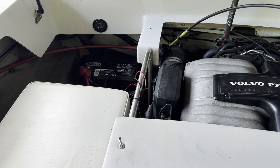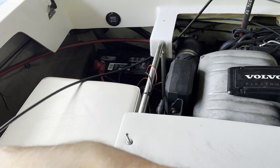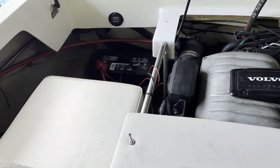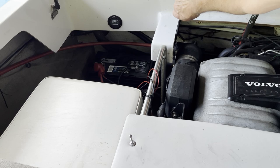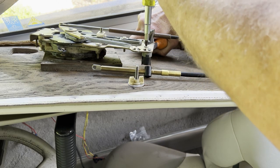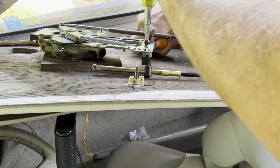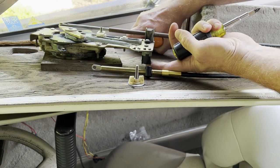When fishing this cable through the rest of the boat, be very careful with the bending radius — I think the spec said a four-to-five inch bending radius minimum, so be careful when pushing it through tight areas. Now I'm back to the point where the cable broke and we're going to reattach it. I need a Phillips head and something to hold the nut on the bottom side. Make a note of where this is attached.